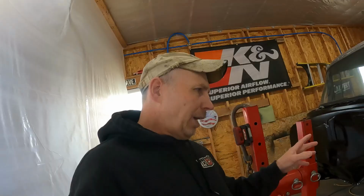The hassle with that is I have to sand everything. This stuff is a little different if you've never used SPI Epoxy, or maybe it's not different. I've never used a lot of other stuff, but I know usually if something sits for a couple days and then you're going to spray it, you want to sand it again. This SPI Epoxy, they say you have a 7-day recoat window. I kind of hemmed and hawed and decided I was going to respray it, but I lost the opportunity in those 7 days because the weather didn't cooperate. I couldn't keep it warm enough. So now I'm beyond it. I'm at like 12 days.